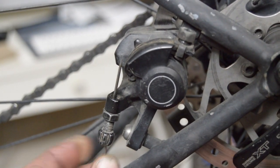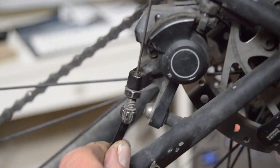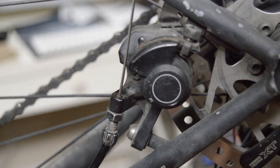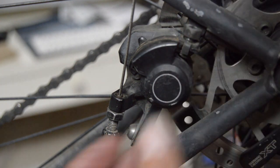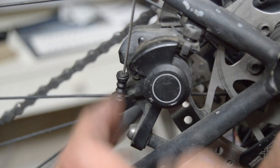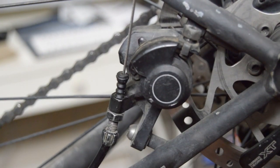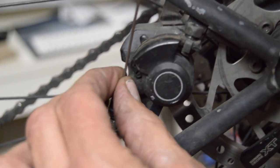There's this little Teflon tube piece that's going to fit through there — slide that on and slip it up through there. I had this little rubber piece here with a slit on it. What happened is I would ride and water could get down in here, and then when it's sub-freezing it would freeze down below the bottom bracket and the brakes would lock up — so that piece helped somewhat with that issue.